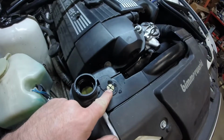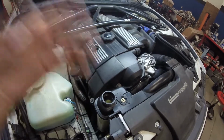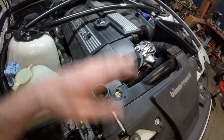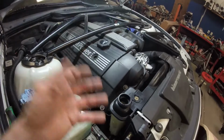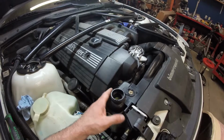So it turned out to be a quick coolant system bleed that turned into 3 hours or more of trying to get an air pocket out of my damn car. I thought that this right here was the vent to allow the air to escape and the system to bleed. So I've been having the front of the car elevated, and this open, and it didn't help with the air pocket at all. Finally, I got smart enough to loosen the cap without having the coolant just spill out, and I started feeling it vibrate and thump like air bubbles were coming out.